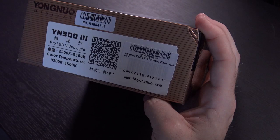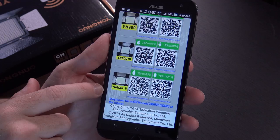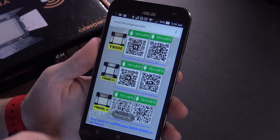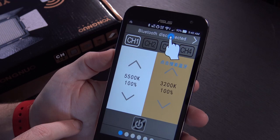We should try controlling it with the smartphone app. On the side of the box there's a QR code. Scanning it gives a URL mentioning Yongnuo and apps - it supports the YN900, YN300 Mark III, and YN600L Mark II, on both iPhone and Android. Clicking the Android version gives an APK file. You'll need to go into security settings on your Android device and enable unknown sources, otherwise it won't install. Once downloaded, we run it and the app is installed.